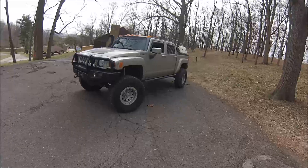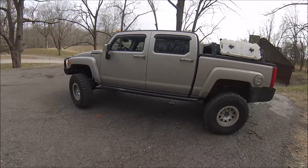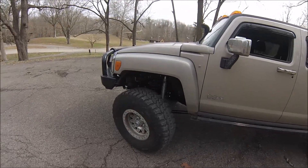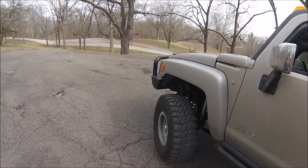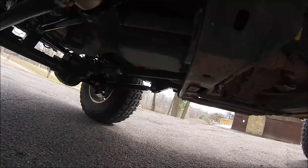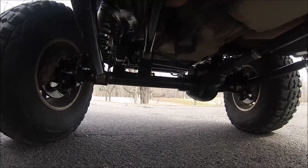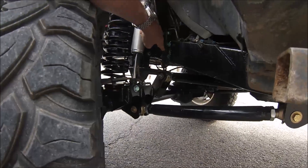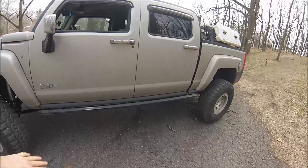It's sitting pretty tall — about probably 6 inches over stock. You might need a stepladder to get in it if you're not tall. I'm 6 foot 2 and I don't have a problem with it. The ride is really nice — three link and coil springs rides really nice on the highway. This truck is sprung pretty stiff, and that helps it handle pretty well for a solid axle truck. There is no front sway bar. Underneath there's the high pinion, a new drive shaft from Patterson with a 1310 CV joint on the end. Urethane bump stops. There's the upper link tower and upper link. It's a fairly low sitting truck, with lots of room to put longer shocks on, move these brackets down, and raise the truck up to get a lot more travel.